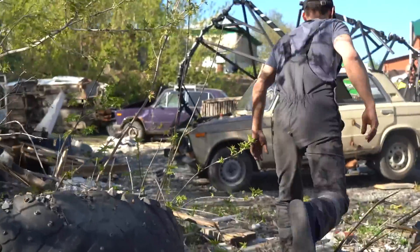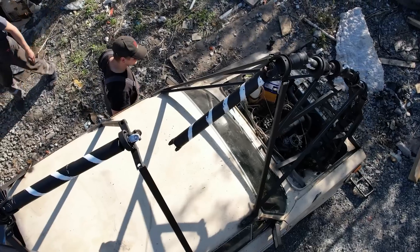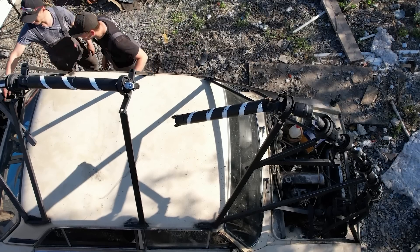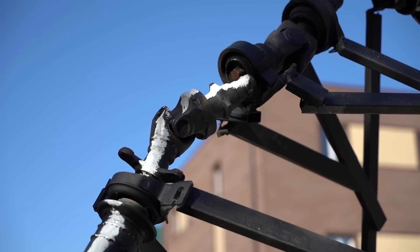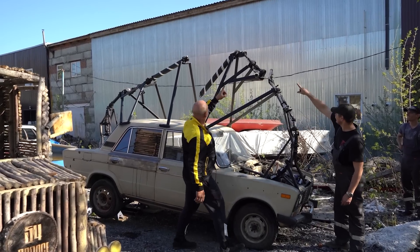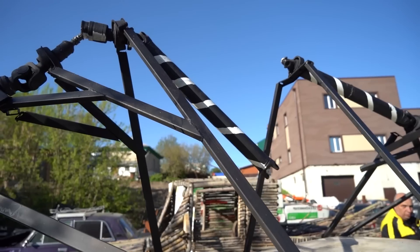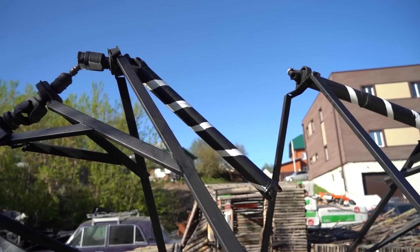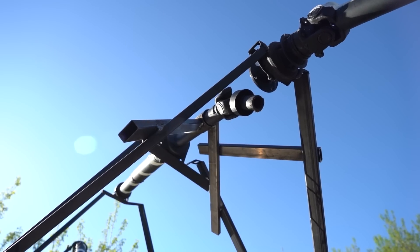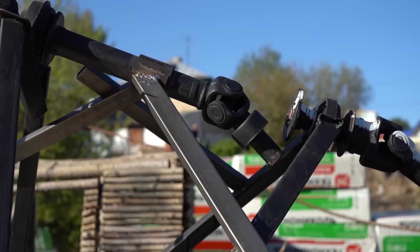What have you done, Nik? You've broken that masterpiece of a prop shaft that we made. It is... well, there are a few shreds left — pieces of it. Holy cow. Switch it off, please, no use letting it run. It was doing so well while we were driving slowly. But our high RPM testing has resulted in... those were the balls evacuating the CV joint. Here instead of a uni joint we were running a CV joint. Stuff fell apart — broke off in three spots with broken connections, and in one spot it flew apart spectacularly.